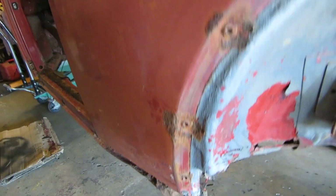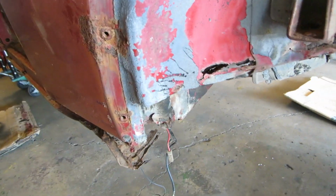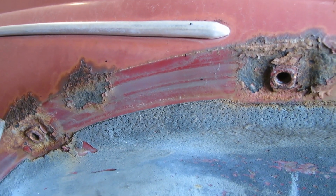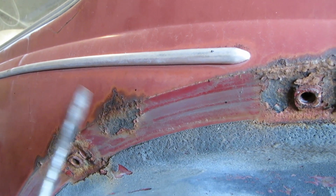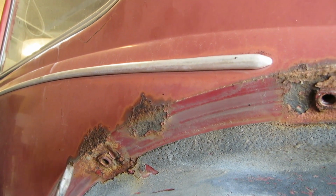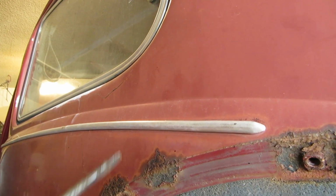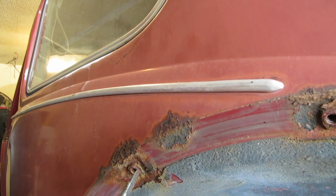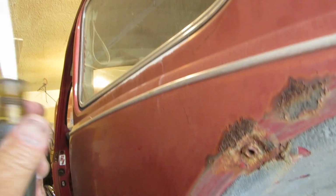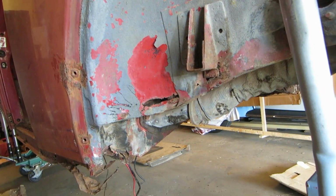Now, this vehicle has never been painted, and it's never had any body work done on it. So that's nice. What I'm going to do is try to patina this. If you notice, it's got the gray primer showing through. If I have to fix something, maybe grind this and put a coat of fiberglass on it, there might be some pinholes like this. In this area right here, I'm just going to tape it off, and then paint it with some white base coat. I'll put a little gray in it, it doesn't matter. Then I'll pull the tape and just dust it, so this area will be a little faded and match the whole scheme of things. Same with holes. If I have to fix a hole that's right out front where you can see it, I'll have to put a patch on there.